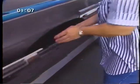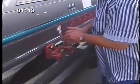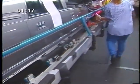Here at Arlington, all the worker does is expose the tape, line up the fixture to the car, and press, roll the moldings to get the best adhesion to the car as possible. And that's how the dealer needs to do it, too. We try for a 1 millimeter gap at the top of the molding edge in the sheet metal. With the door open, the fender character line should match up with the molding curve.